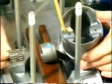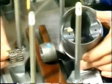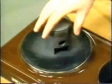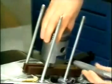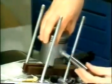Whenever new parts are installed, make sure all components such as piston, gudgeon pin, connecting rod and small end bearing correspond with the color code shown in our mating table. Heat up the piston to approximately 50 degrees centigrade. Guide the cold gudgeon pin by means of the guiding pin into the piston and connecting rod with fitted needle bearing.